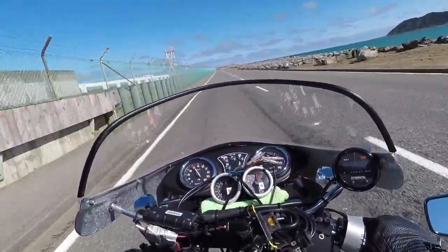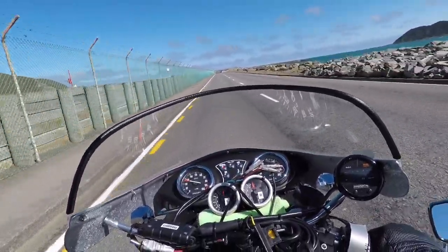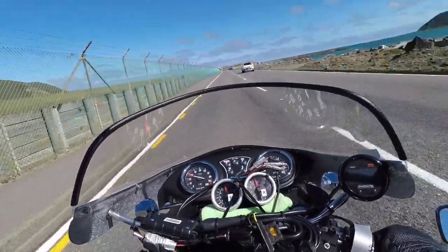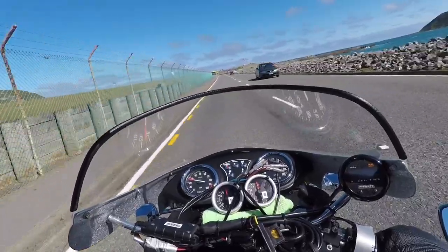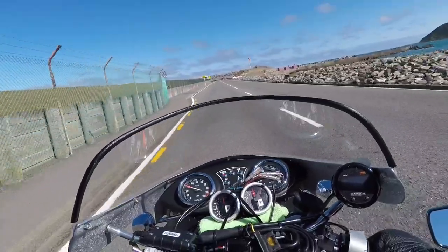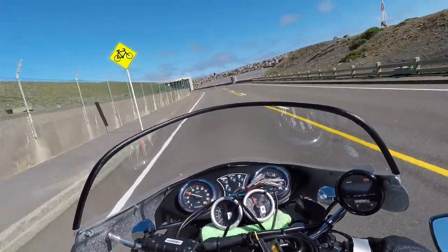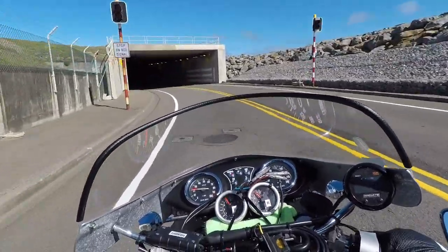Oh, and it went rich. Okay. I'm going to go up a gear and do the same. 10.8, 10.1, top one's a little bit leaner, and now 2,500 RPM, wind it on. Okay, it goes very rich. Even then, the maximum, it went lean when I throttled it, so it went up to 13 and a half or so. That's interesting.